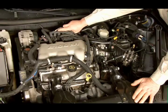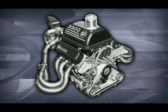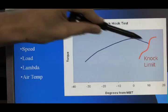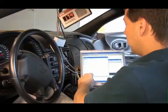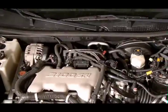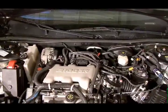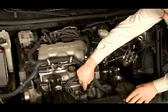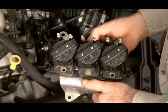DIS ignition systems evolved from conventional ignition systems. These distributorless systems were first seen in high-performance racing vehicles. A DIS ignition system has many advantages. Calibration engineers have better control of spark and timing events with fewer moving parts, which means fewer parts that can wear out and require maintenance. There isn't a distributor driven off the engine in a DIS system, so the engine runs more efficiently. The high voltage plug wire runs directly from the ignition coil to the spark plug. And since a DIS system only requires one coil for every two spark plugs, the coil itself is larger.